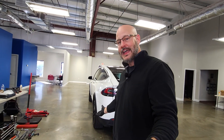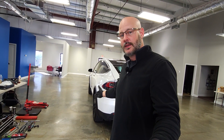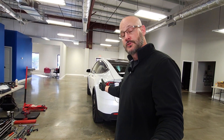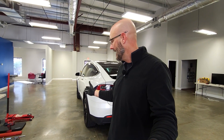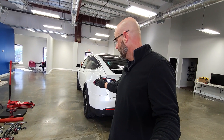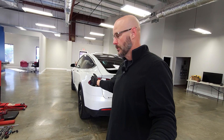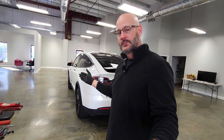As you can see, I'm on very high and you can still see that the bottom of the tire is sticking out. The toe of the tire is what people often misdiagnose this as — toe is how far the wheel is pointing left or right, whereas camber is the tilt in and out. So this is a negative camber issue.